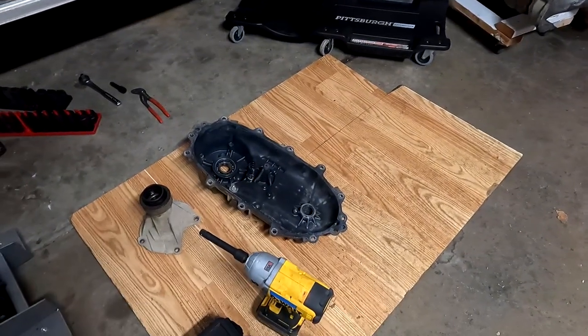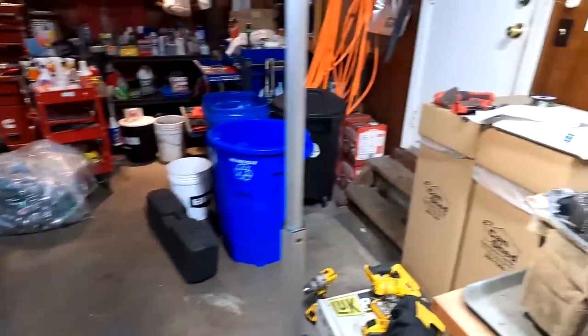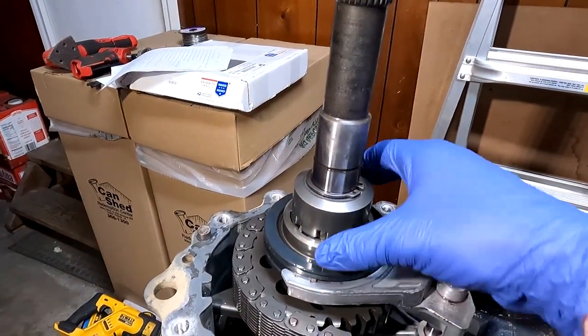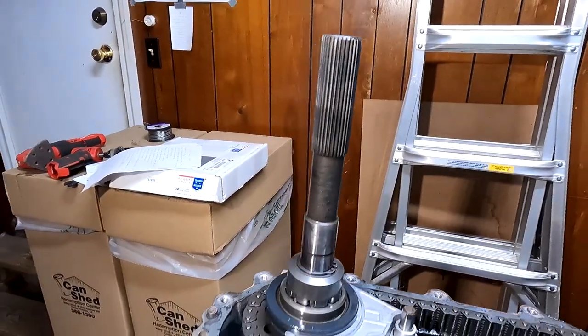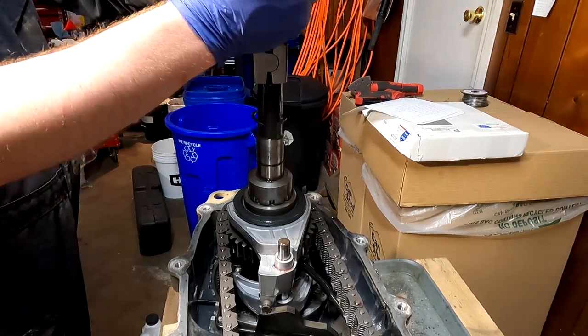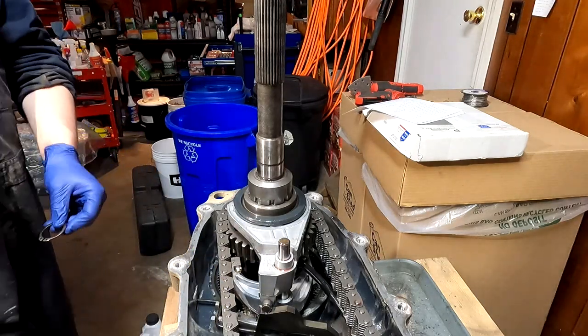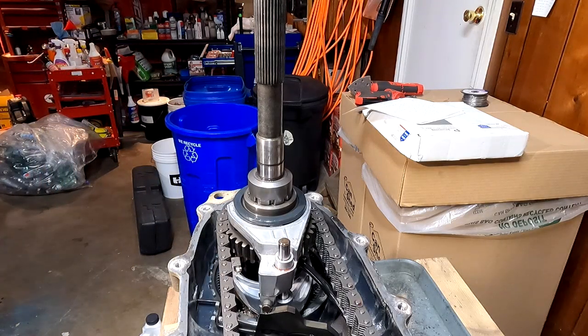Now that we've got the top case off, there's a snap ring right here that we're going to remove, and then we're going to slide our four-wheel drive lockup assembly off the shaft. That was a big old beefy snap ring - that's why I say having a good beefy pair of snap ring pliers is so important. See how easy that was? One of those cheapo pairs of snap ring pliers from the auto parts store - oh boy howdy, that would have been a nightmare. We're going to go ahead and slide the lockup assembly right off the shaft.